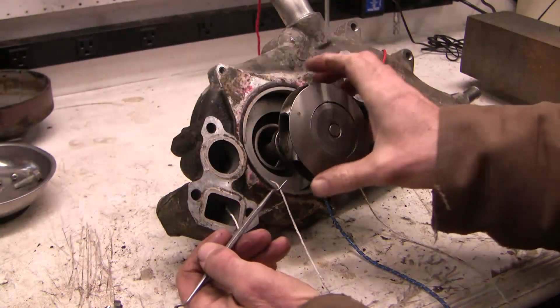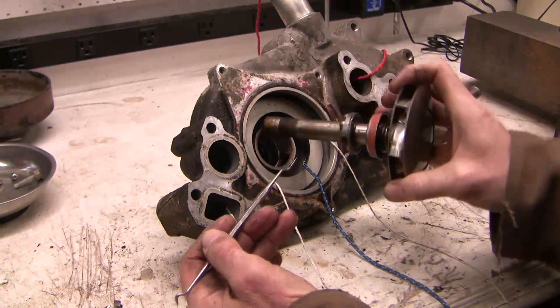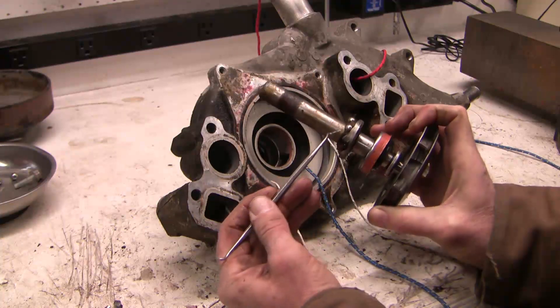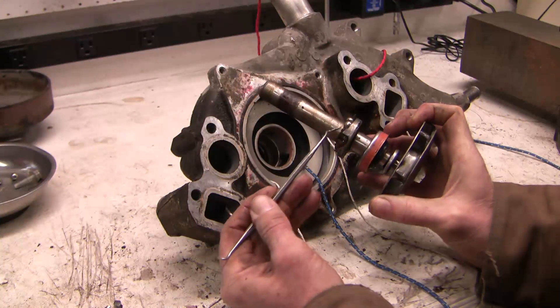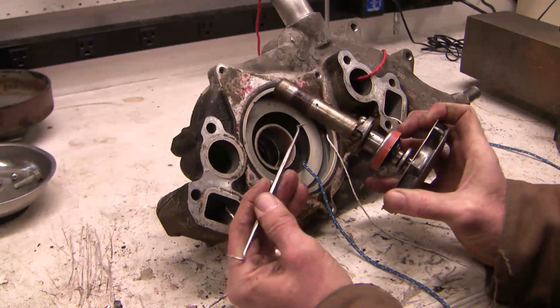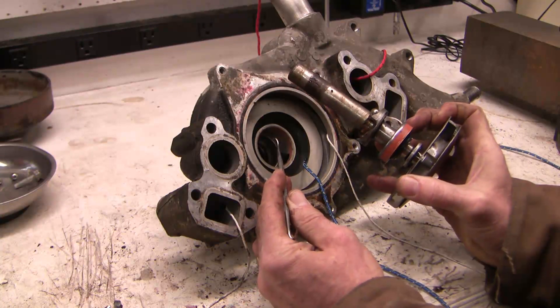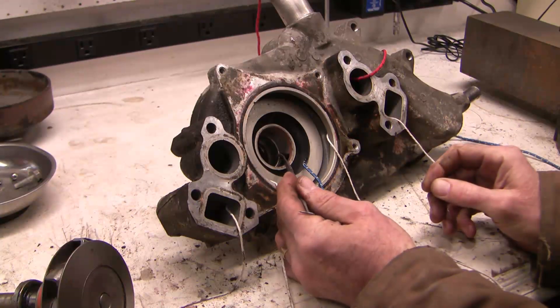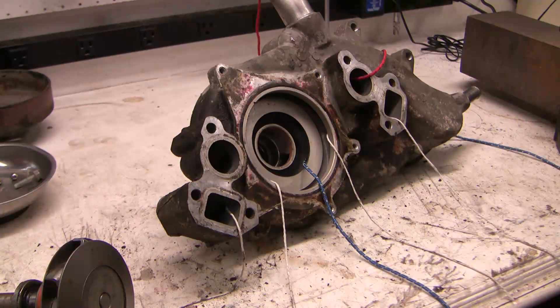Alright, let's have a look at this. What you have is a set of ball bearings — you can see that the fracture line is right on the set of ball bearings — and then deeper inside, a set of roller bearings. And you can see here, here is the weep hole.